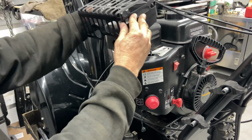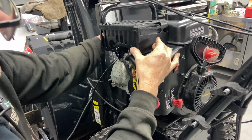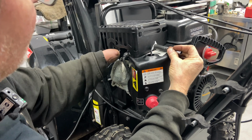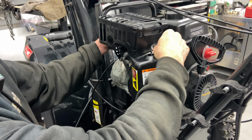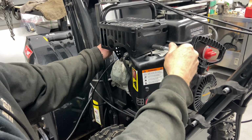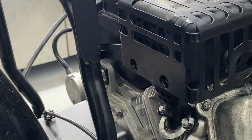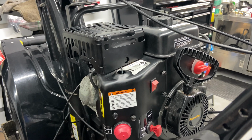Now you have to put the big guy on over, and it slides over. Going to go ahead and put the paper towel on top of your socket, and if you put the bolt in there, it shouldn't fall out. It shouldn't. Then we have to find a spot where this can be a little bit tricky, so you're just going to have to try to line it up the best you can. Once you have it started, then you can pull that paper towel. Don't forget this one down here that we put in hand tight.